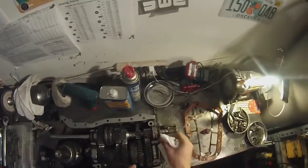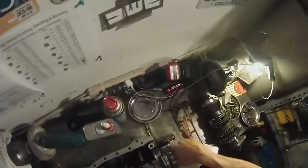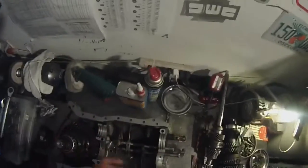One thing I like to do is apply Loctite 609 or 648. 609 is my favorite — it's for loose and press-fit cylindrical mating components, so it's really made for bearings on shafts and bearings on housings. This is a really good idea because throughout the life of your transmission, depending on how tight your case seals, you could have a bearing spin in there, which really wouldn't be a good situation. You can actually see a little bit of wear in here where that kind of thing has happened, so that's what we're trying to avoid.